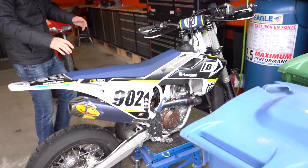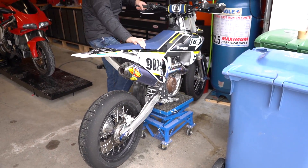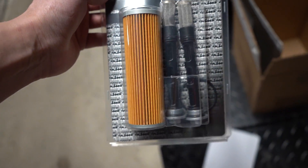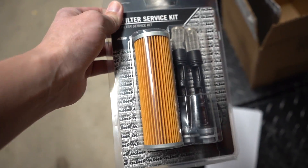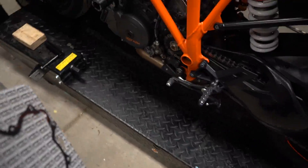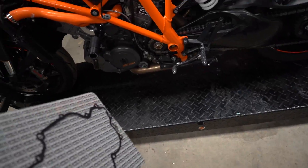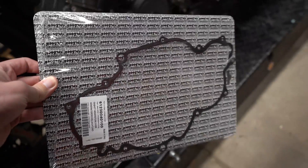My microphone was breaking during all this. I'm talking about the oil filter kit, which is a full kit versus having just the oil filter — it comes with some screens and stuff. And here's a new gasket for the side that's kind of seeping right there. It's coming out from the stator cover, so that's getting replaced.